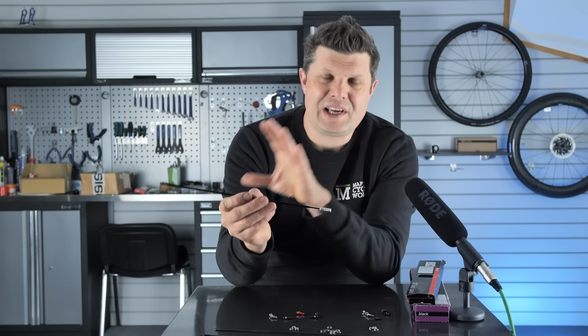Okay, quick recap then. First, choose the depth, and if you're really worried about the specific aerodynamics, go to another channel, have a look at that. Otherwise, there's plenty of information there to look at. Once you've chosen your depth, then choose your type, whether you need to go hooked or hookless. And then once you've made that decision, then come and look at your rim width and do all of those calculations that we talked about to make sure that you can run the size tyre that you need to run for your frame at the right pressure for your body weight safely. And that is how you'll eventually narrow your choice down to the perfect rim for you.